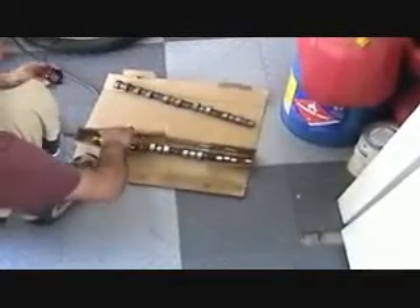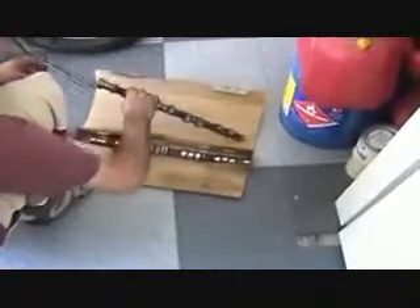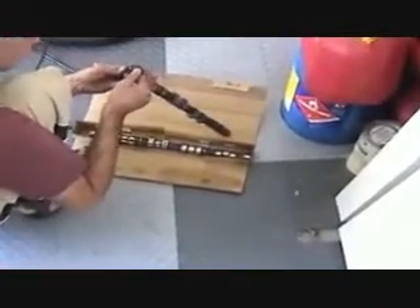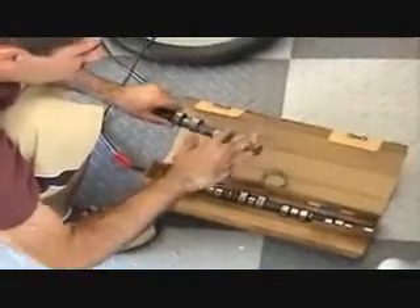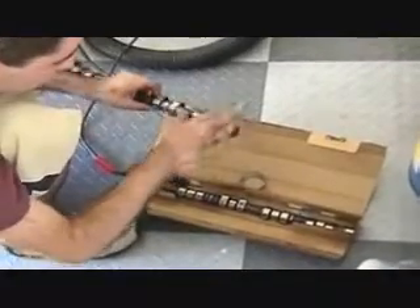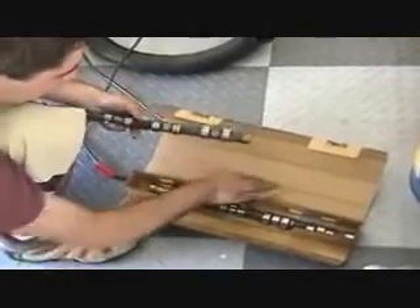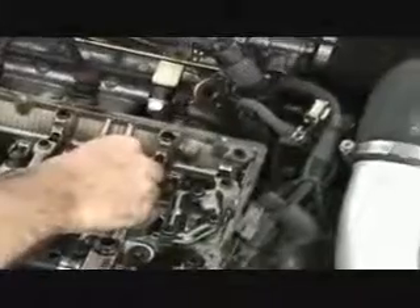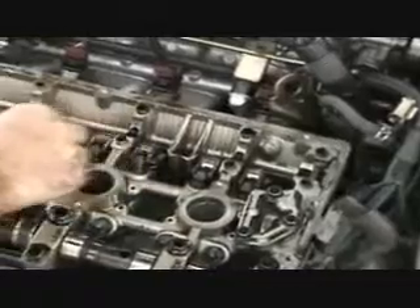Here I'm removing the stock cam, and then taking off the oil seal from the stock cam and putting it on the new cam. Just inspect it to make sure it doesn't have any cracks or anything. Then liberally put oil on all the shiny parts of the new cam. The oil is just going to lubricate it for the first few seconds until there's oil pressure in the motor. You can also use assembly lube.